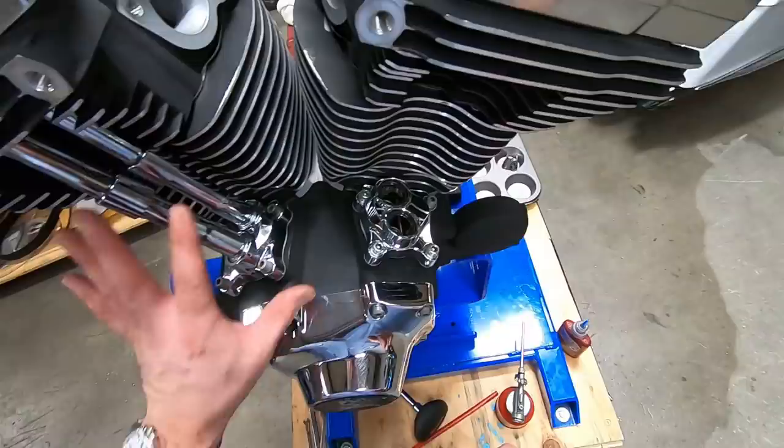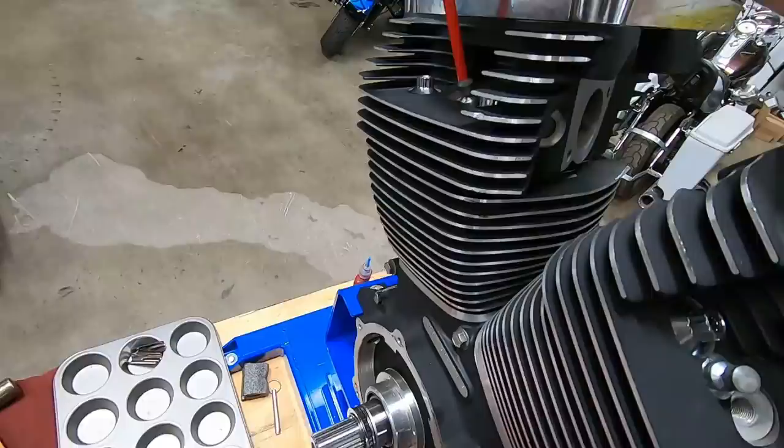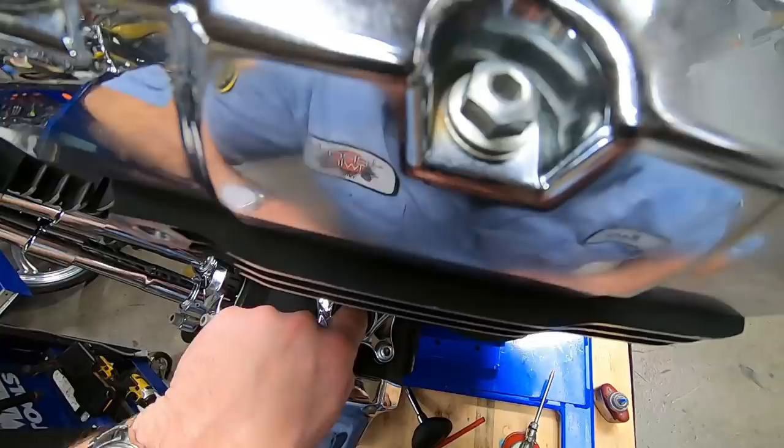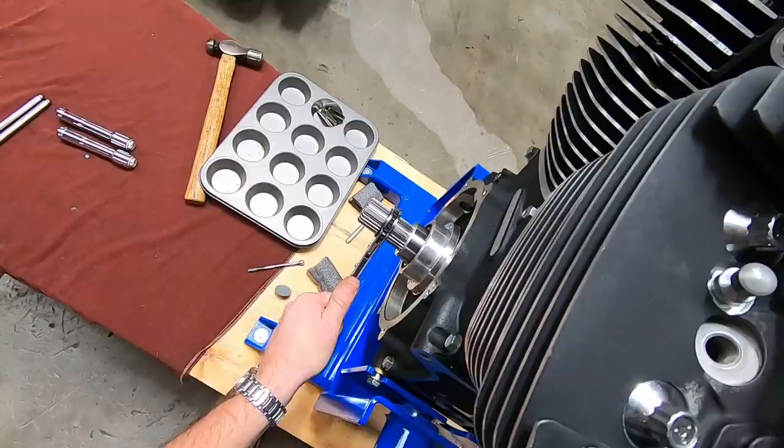All right. So again, let's grab our straw, come back over here, and let's get the piston up to TDC. We are at the top. Now let's see if our lifters are all the way down. And they are. If you're not sure, put your finger on the lifters, spin the engine slightly, and you should not feel the lifters move. And our last clip.